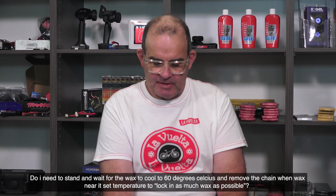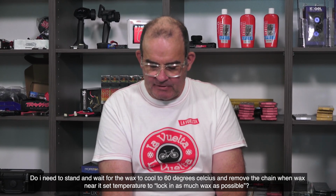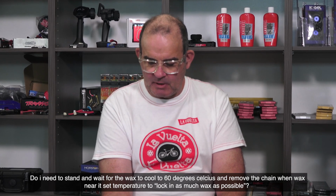So, okay. Do I need to stand and wait for the wax to cool to 60 degrees Celsius and remove the chain when the wax is near its set temperature to lock in as much wax as possible? Okay, no. So this is from another video which comes up near the top when people search YouTube videos about waxing, where the person stands there as the wax cools down and removes the chain when it gets to nearly the set point, and then puts the chain in water with the idea of locking in as much of the wax as possible. So no, definitely don't bother doing that.